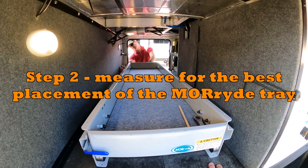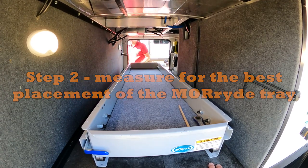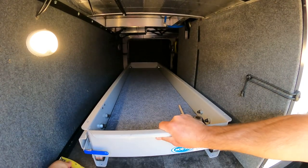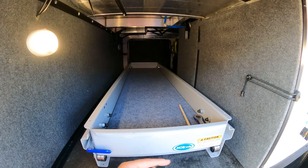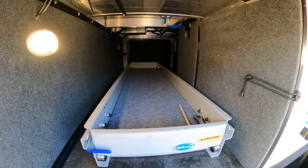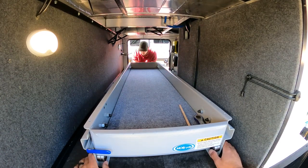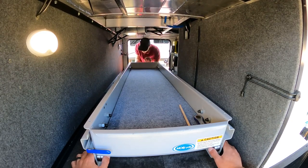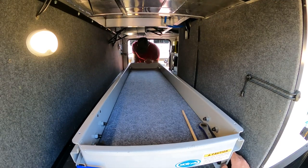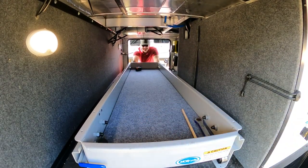Let's try... actually, let's do this one. Just do it off the edge of the feet? Yeah. So that's right at six inches. I guess I got to set it over. So I'm measuring — there it is — we're about perfect. Now you're about your distance in and out. Do you want to check from here? Go from the left to the foot. Five and a half? Five and a half, right on the dot. We're like an inch. So we know we got six and a half inches, so do you want to go three and a quarter? So we're right at an inch. That's two and a half. We're within a quarter inch all the way around. I think we'll call that as square as we're going to get it. I would agree.